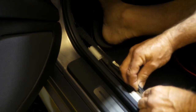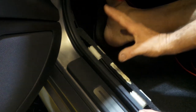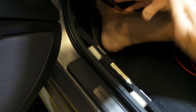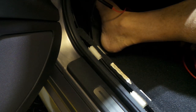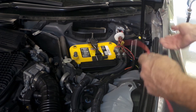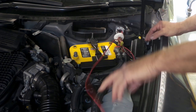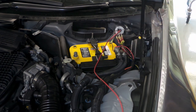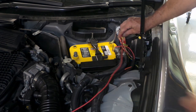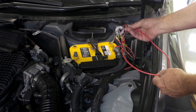Pulling the carpet holes back up and locking them into the plastic pieces, then the sill panel cover goes back on. I crawl under the dash and feed the wire up through the corner using a draw wire I already had in place through the marine fitting into the engine bay, and we are through to the engine bay — pulled through easily with the draw wire. Now just put the cap back down, insert the rubber grommet, and seal it back up.